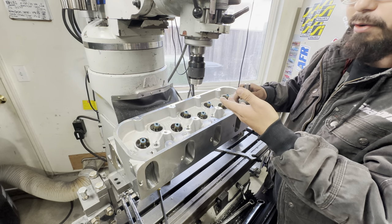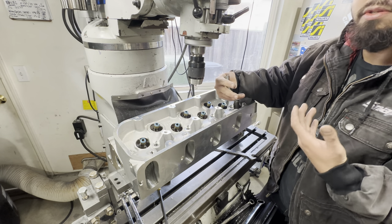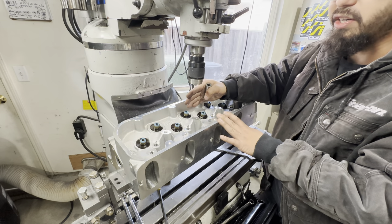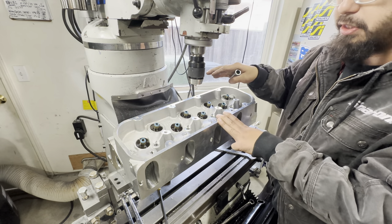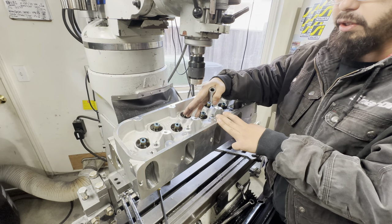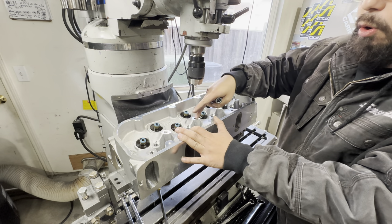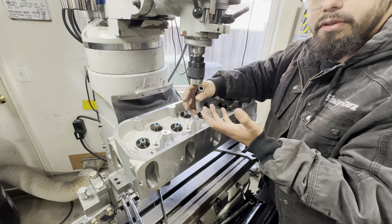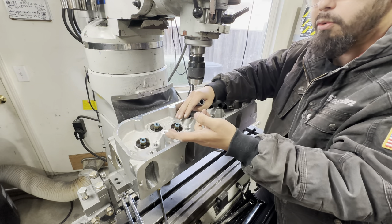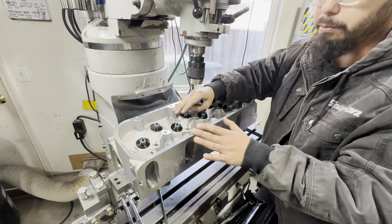I am seeing a lot of comments now that my channel is getting a lot larger — people claiming that you can't use a Bridgeport for automotive machining. If you see those kinds of comments, chalk it up to inexperience. A lot of people just don't live in the performance realm. People doing higher end machine work are going to do a lot of their processes in a Bridgeport or milling machine. There's just a lot of things that a seat and guide machine cannot do that a Bridgeport has no problem doing. For example, I can actually manipulate the angles of my rocker stand if I wanted to. A lot of aftermarket heads have the rocker studs machined at the incorrect angle — some Cleveland heads or some 460 heads have that issue. A seat and guide machine would really struggle to make corrections like that. Most seat and guide machines use an air float table — that adds to speed of setup because you can self-center using the air float table. Everything on a Bridgeport is rigid, so I've actually got to use my digital readout to go off of coordinates. On a seat and guide machine, since it uses a floating table, you're going to center off of the original hole, and if that hole wasn't machined on the correct bore spacing, you're going to follow that incorrectly machined hole.